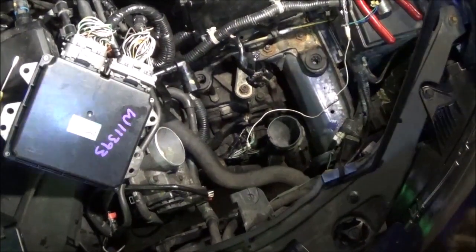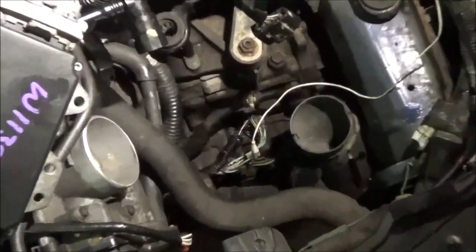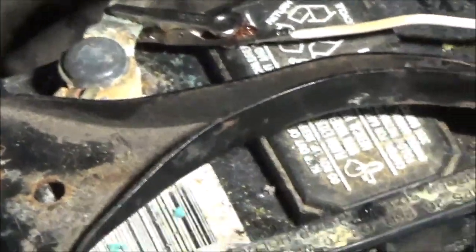Alright, if you look at this here, I have that wire cut down there. It's cut, and I have this wire hooked to it, and it's hooked to there, and it's going over here to the solenoid right there. So it's hooked over here to the solenoid, to the green wire. Then I have another hooked to the blue that's going over to the battery ground over there. Okay, so now I have the solenoid grounded. I have the control wire hooked to a solenoid that's on the outside that has the right ohms. Okay, you saw what I did.